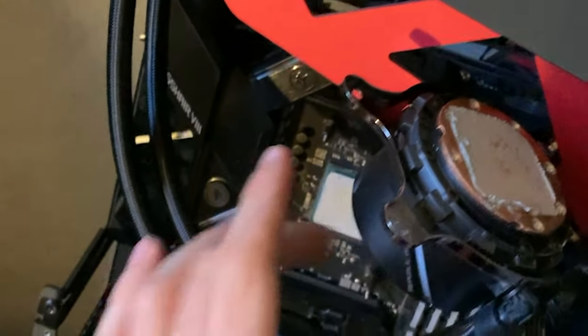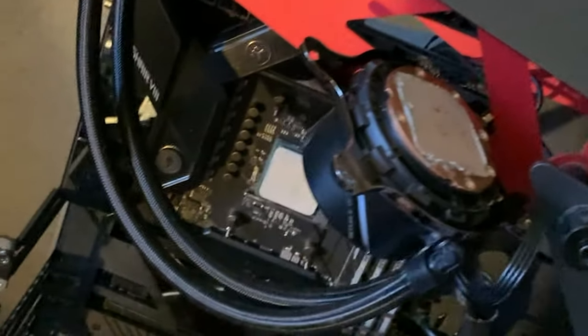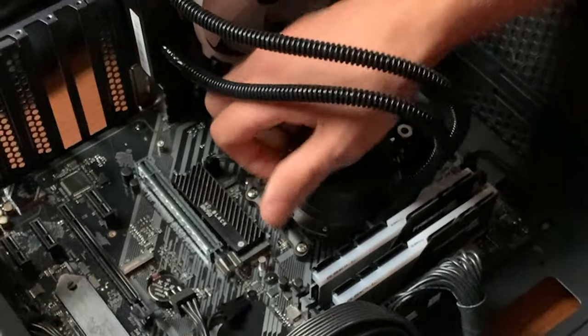Cleaning up the paste now. Pro tip: don't leave your AIO cooler just hanging — lock it on the case. It's made exactly for that, just lock it there. Now time for the actual CPU swap — let's hope it doesn't come out stuck to the cooler, as usually happens with Ryzen.